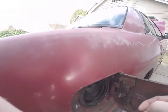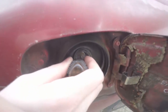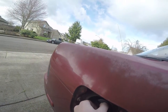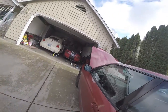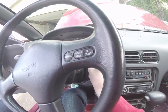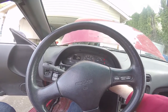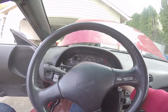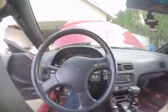Going around here to take this fuel cap off - look how moldy that is. Then poke with a screwdriver to open up that valve and make sure all the pressure is relieved. We're gonna leave the cap off while we crank it up for about five seconds. Hopefully nothing bad happens - never done this before.